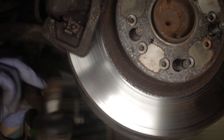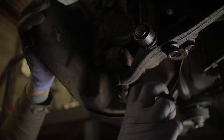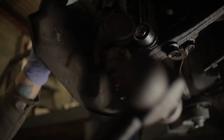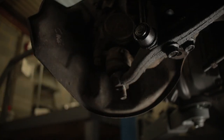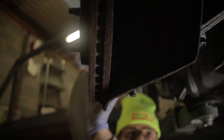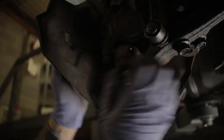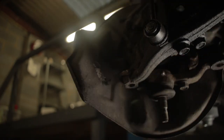That's one part done, now let's tackle the actual ball joint. We're going to undo the circlip and then whack it a few times to try and break the taper. We are going to be reusing this ball joint so we can't be splitting the rubber. It's loose — it's just because of the coilover it acts a little bit differently. Let's take this off now.